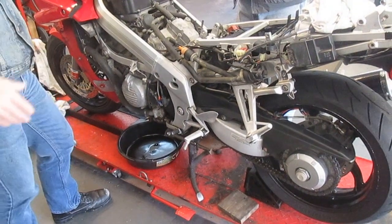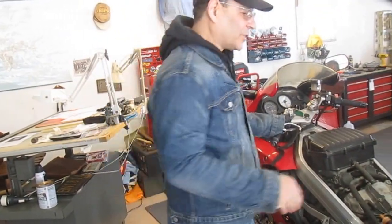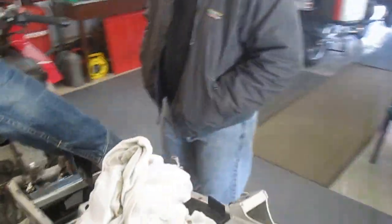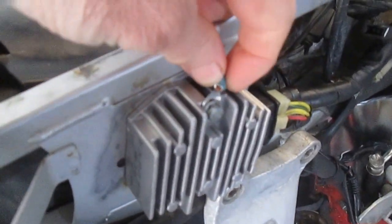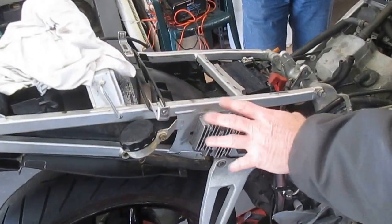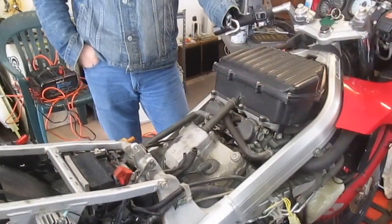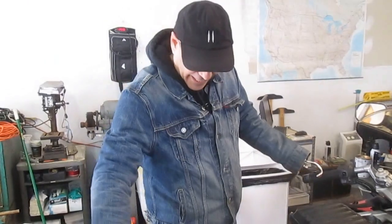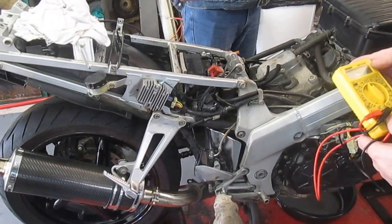We went for four or five rides and then there was another ride where you never got home. I got to the stoplight and then it just went. You know the battery's shot. Then you went to a dealer. The dealer said that my ground wasn't good. He actually replaced the ground wire and put this guy on. He also gave me a new regulator rectifier. Once he changed that, the bike ran fine for a while, but then it happened again. So that's when I just put the bike on a trailer and brought it over to Vince's house.